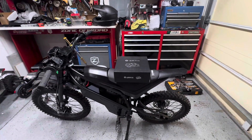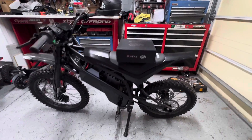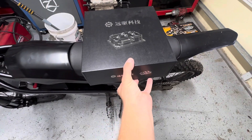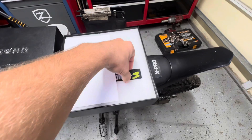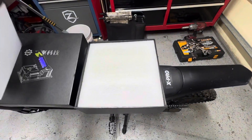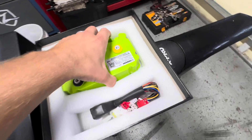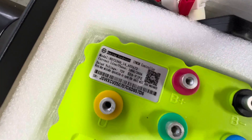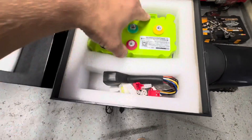Just like I told you in the previous video, we're going to be tuning this thing and pushing out as much power as we can. We got our new Far Driver controller — already downloaded the app on my phone. We got this from Econic Cycles, I'll put a link in the description. This is the 72-360 model, good up to 190 amps. We're going to push it around 120 to 130 amps.